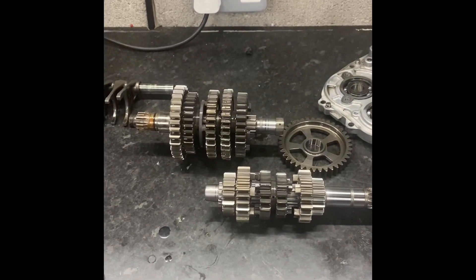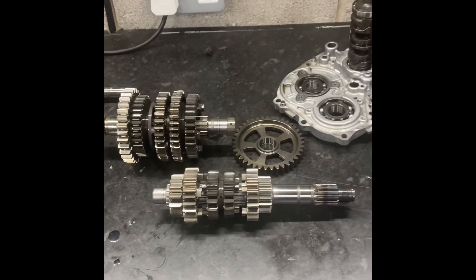We're obviously not going to do a video showing how we put it all back together as you've roughly seen how it comes apart. Cassette gearbox is much easier to work on, takes a lot less time, and is well worth a little inspection for winter maintenance. I've checked out this gearbox in between videos and it's absolutely fine — no excessive wear, no excessive movement. It gives that peace of mind. It will take us approximately an hour once we've got the clutch removed to do the necessary checks, inspection, stripping down and putting back together. So there's another video for you — if over winter you're considering this kind of job, hook us up. Any questions, drop them in the comment section, or check us out on Facebook or Instagram. Thanks for watching.